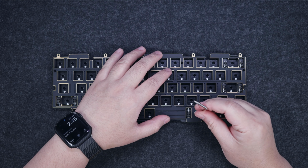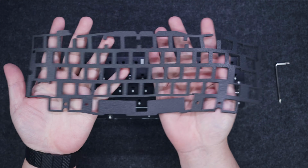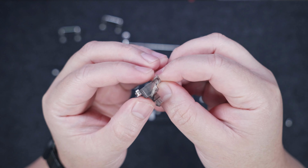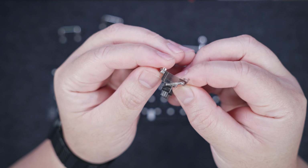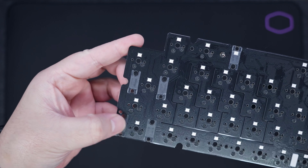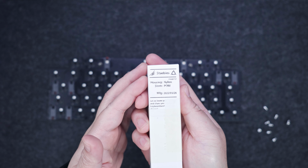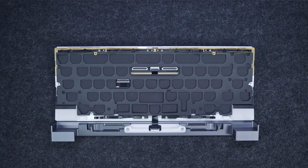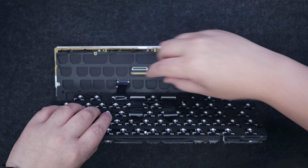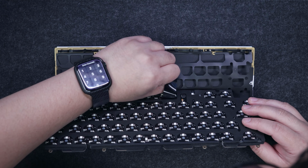After that, remove the 2 screws at the sides of the space bar using the included small screwdriver. Now we have access to the plate foam dampener, the switch pad, and of course, the stabilizers. The stabilizers are pre-lubed out of the factory and generally decent for this pre-built variant. We also have a stabilizer dampener here on the PCB, which is good to see. I actually replaced the stock stabilizers with AE Board Stabis V2, but I'll share the complete sound test on the full review. Overall, I was able to tear this keyboard apart multiple times now, and I'd say the experience is worth the while, especially if you want to experiment with each and every possible configuration with the leaf springs.